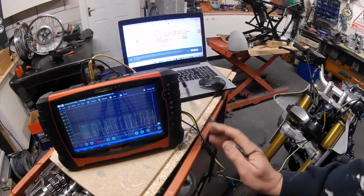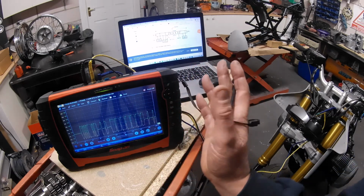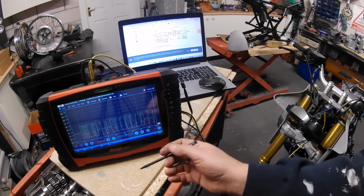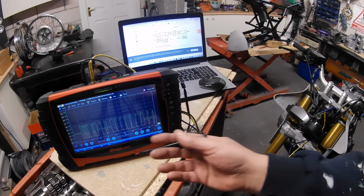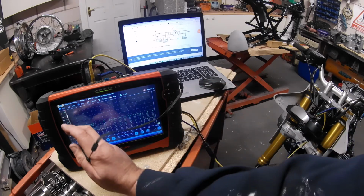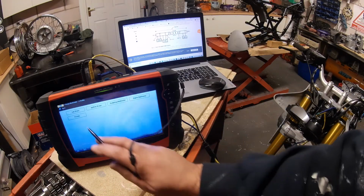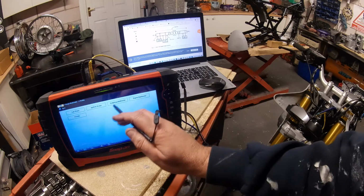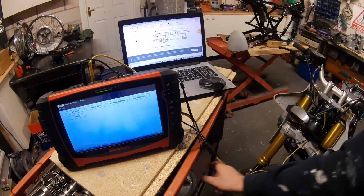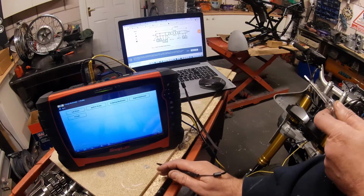We know the CAN signals are really good. If you saw these square signals leaning, there are all sorts of different reasons why you can get failures, like a short to ground, a short to positive, or a broken wire on the CAN high or CAN low. But anyway, they're all diagnostic issues. For us, what we want to find out is whether we can remove these clocks. So we need to find where those resistors are. The actual brain that the resistor's in, we can't remove.